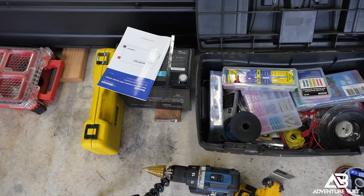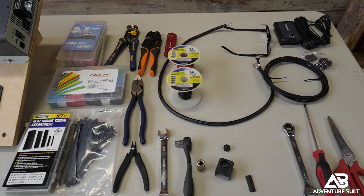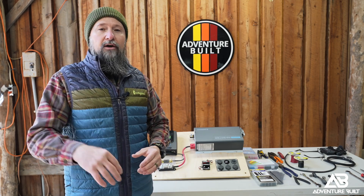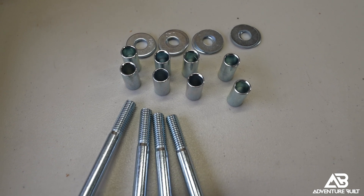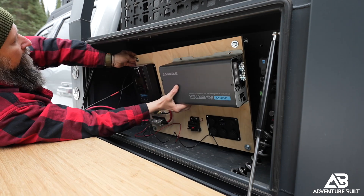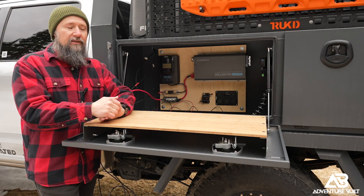It is an investment in time, knowledge, and tools — my pole barn looks like an electrician threw up in here. There'll be links to all the tools in the description, as well as the entire Renogy system and accessories. Day three is off to a great start. We got the panel completely installed — I was waiting for different spacers because the DC panel needed two inches of clearance in the back. The spacers I got worked well, the thing is in here really solid — mounted in four points right to the aluminum box and dead solid.